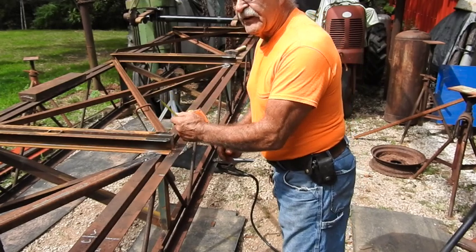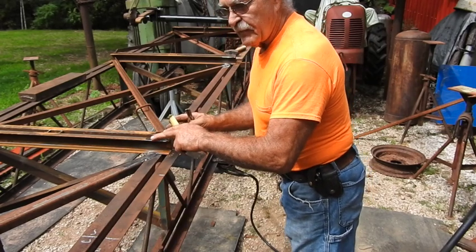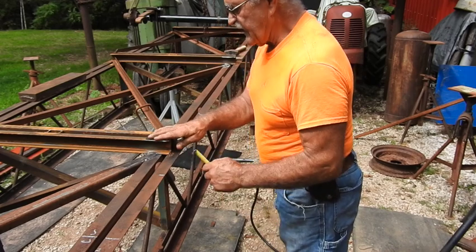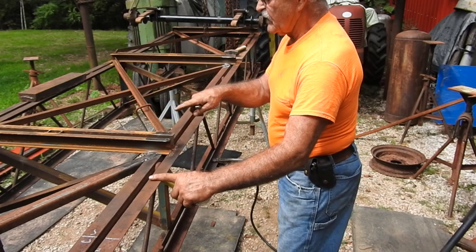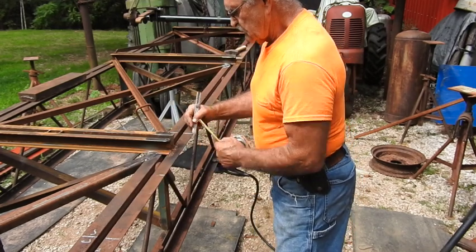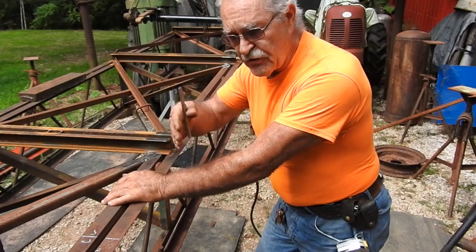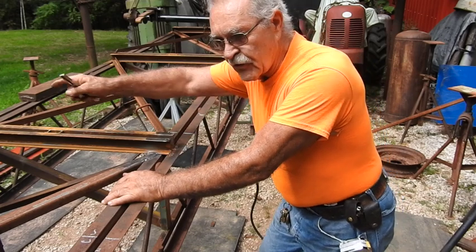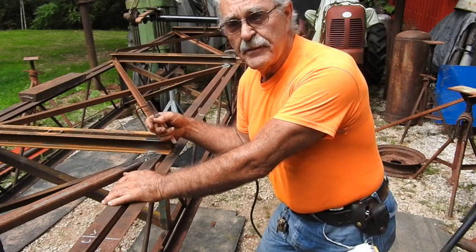What I am going to do is place the axle just a little bit to the rear of the center point. The reason being is I've got my reinforcement channel irons here, and if there's a little flex in those springs going over rough terrain, I don't want the springs to bottom the axle out on these. So the leading eye is going to be over here, the arch of the spring goes over the top, the axle is about here, and the arch of the spring goes back down. It's actually only eight inches off from the regular calculation. This will give us a proportional amount behind the axle for whenever you turn — if you have too much back behind the axle, the back end wants to sweep. And if you have the axle too far to the rear, your turning radius becomes monstrously huge, especially with a four-wheel drive, long-wheelbase, eight-foot bed truck in a tight spot.